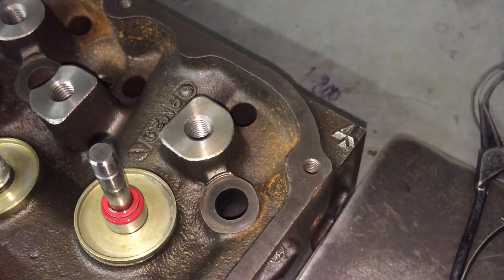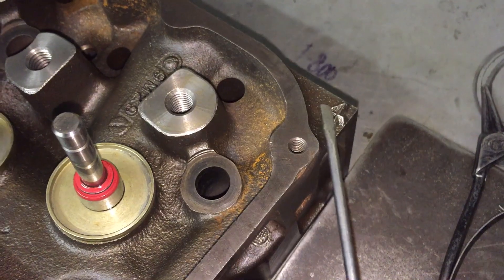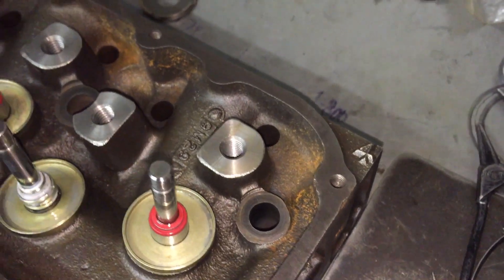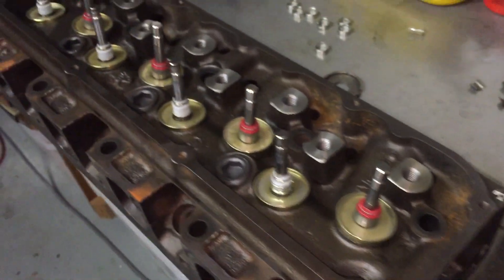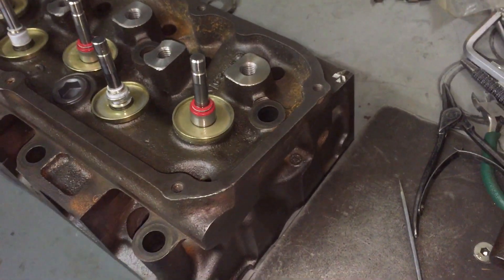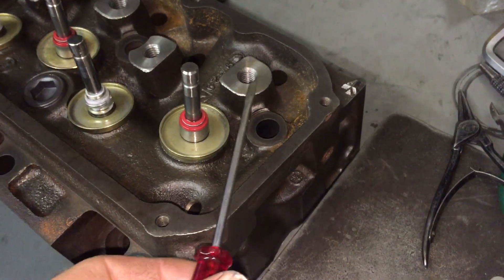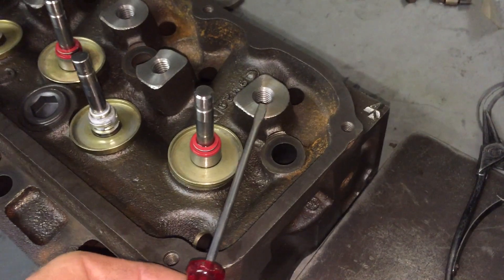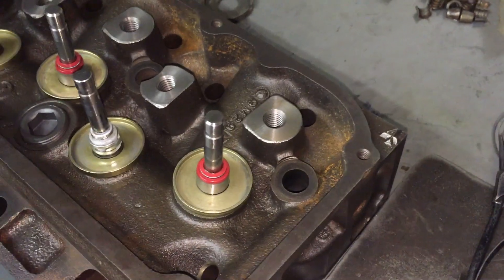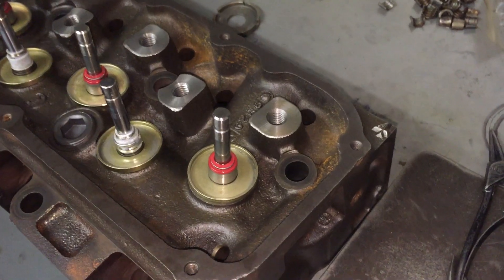Back in the day, just to make sure that the people picking parts off the shelf were absolutely clear on what heads went on what engine. There's no way any parts picker at Ford would have mixed these up, because the small port 2V versions had a two cast right here. Ford didn't continue that as they went on producing 351s — they just deleted this, and over the years this space became empty with no numbers or identifying features. The Phase 3 engine, to my knowledge, has just the standard 351 Cleveland 4V heads, and from reports Ford used the standard hydraulic heads and machined the rocker pedestal down to a particular height, then drilled and tapped it to suit a 7/16 stud.